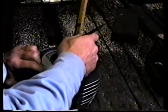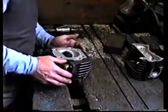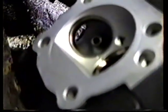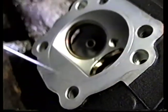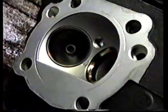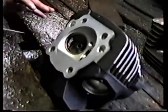We cut all this metal out by hand and we have to be absolutely clear on where the mark is. It's all an eyeball deal — all done by hand and by eye. The object of this is to remove this big lump here in the combustion chamber. The problem with this lump is that it restricts the breathing around the valves and also restricts the flame travel across the combustion chamber. The object here is to make this thing totally hemispherical, to remove all the edges so the flame travels evenly across the combustion chamber and evenly across the piston top.